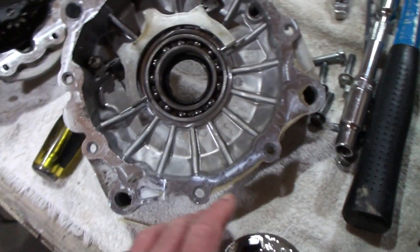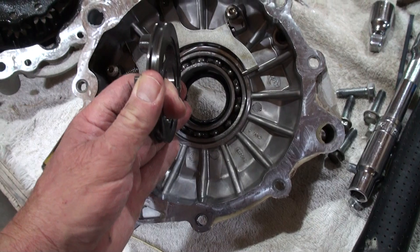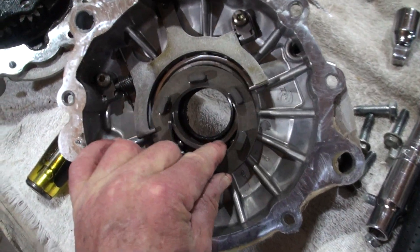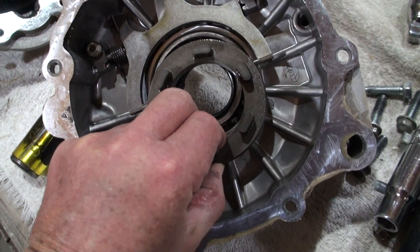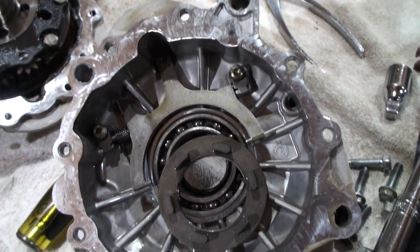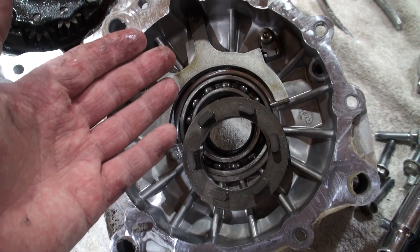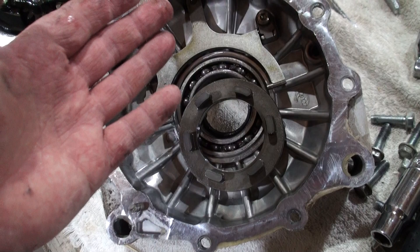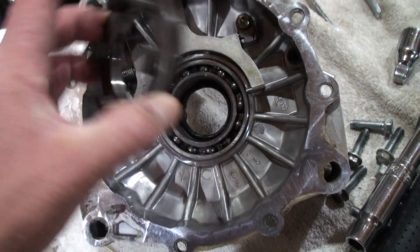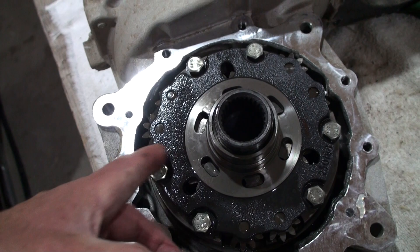Here's your dog with the little shim behind it, which is laying in here, and you can see the groove which goes right up into these little fingers here. When you pull this off, it fits right there. There's your solenoid — that piece here — on the back side. When it clicks down it releases, but without power to it, the dog is pushed in because there's a spring, so it's sprung in by default.